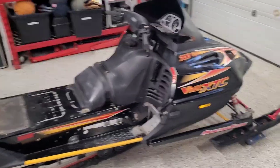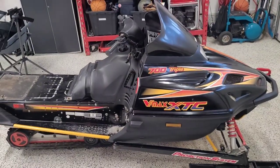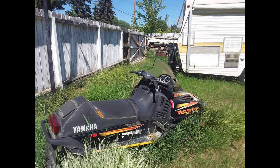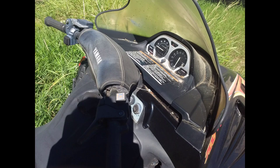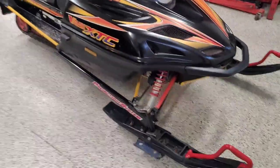She started and ran really good — it's got 120 psi on all three cylinders. I had to get a new windshield bezel piece too, as the original was smashed out. I'll post some pictures in the video of where I found it and what it looked like. There was just a lot of cleaning, getting the grass out of every nook and cranny.